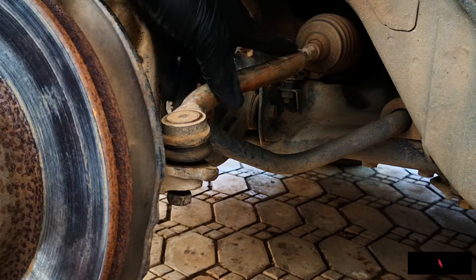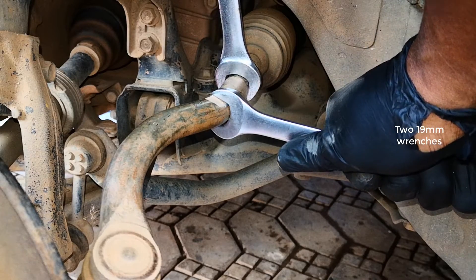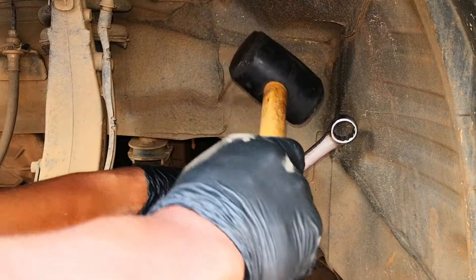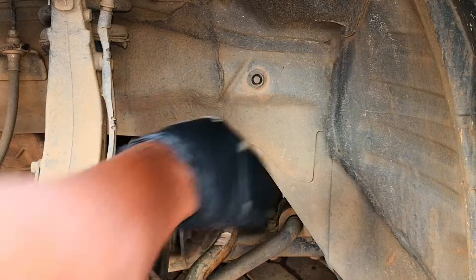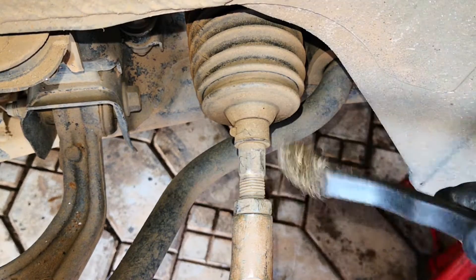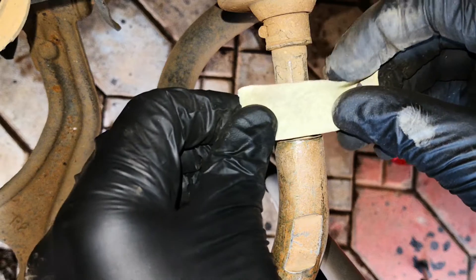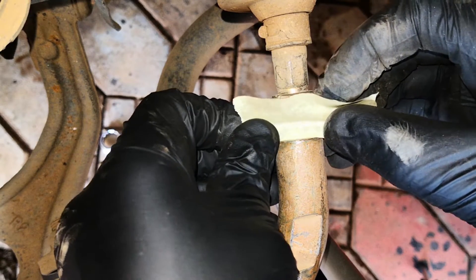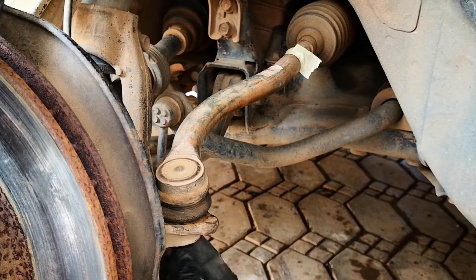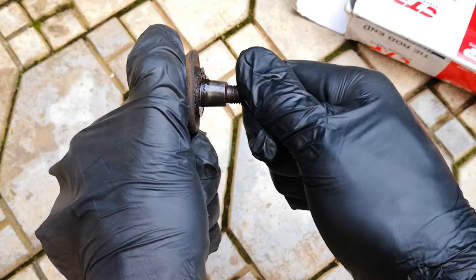That separates it. Next we'll go to the locking nut up there and slacken that. It's difficult, so I'm going to give it a bit of a whack. That's loosened. The thread needs to be unclogged. Thread it back and this is where my tape comes in — whatever you used to achieve this mark is fine. For me I'm using tape, so once I get back to this point I know to stop. You can now unthread this.